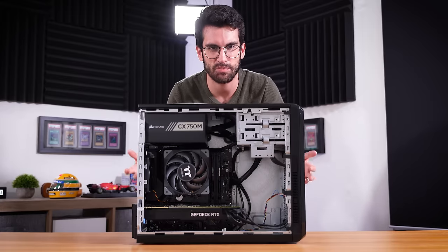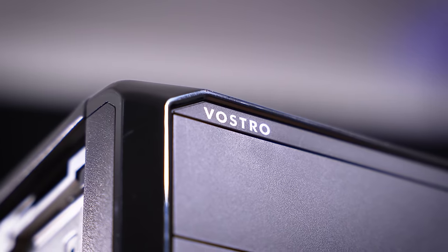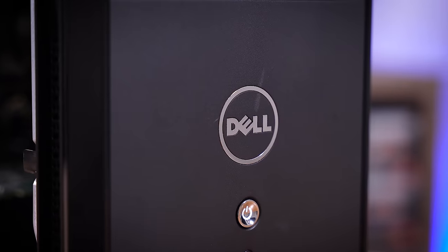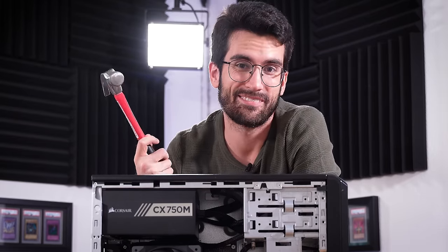Now we can carefully place the platform back in and button everything down, wire everything back up. I've created a makeshift front panel solution for the power switch by just connecting the blue wire to the black lead where it was supposed to go initially, and also removed the extra black wire that was leading to a place it definitely shouldn't have gone. And here we are — the finished product — and it looks identical to the way it did when it entered the office. It's always a relief when a diagnosis doesn't require replacement hardware. In fact, it only required a hammer, which — well, that's a first.